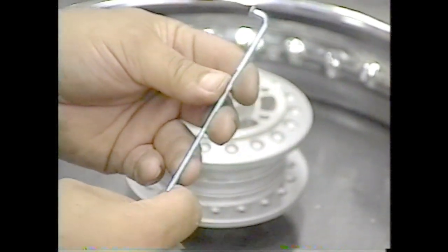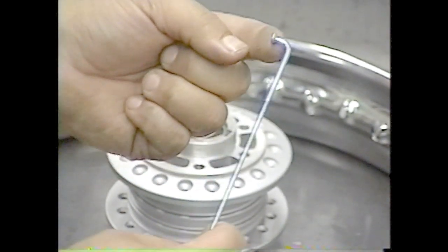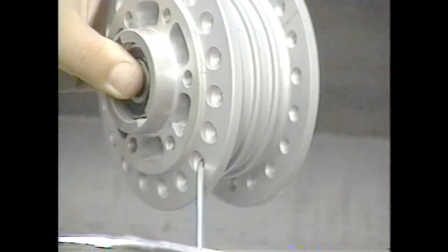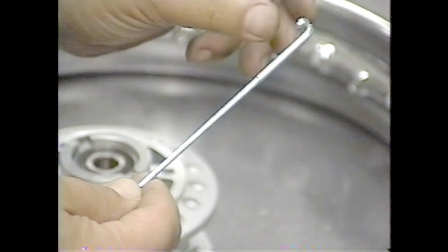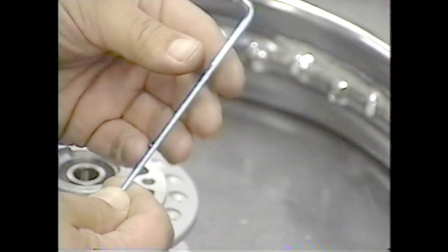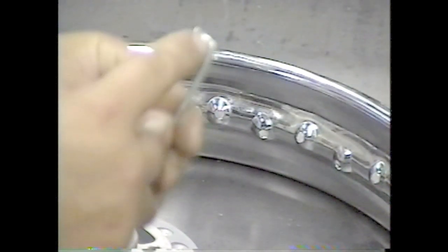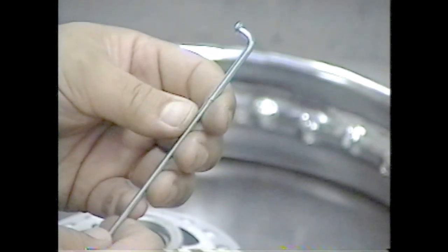There are two types of motorcycle spokes found on most wheels. The first type is called the angle spoke — it goes inside the hub and angles around. The other style is a straight pull spoke, usually found on off-road vehicles. The straight pull would not have any angle at all; it would be straight the whole length. That's a tougher, more durable spoke, because whenever you bend a metal it causes a weak spot, which is why off-road vehicles use straight pull spokes.